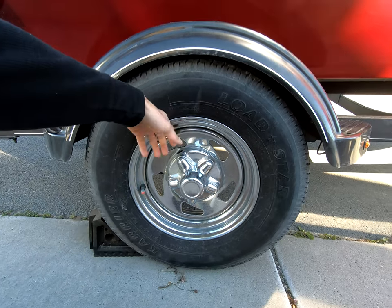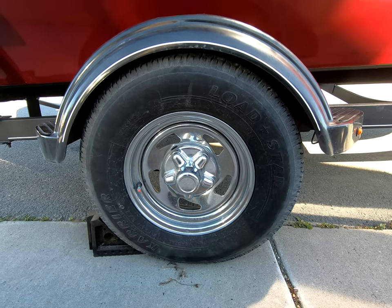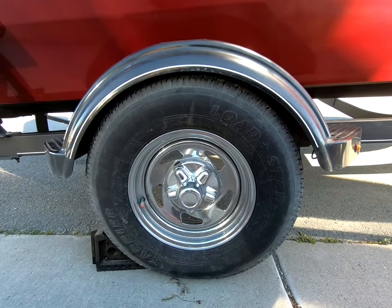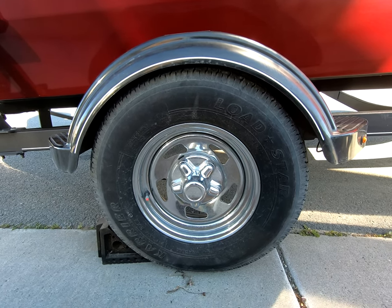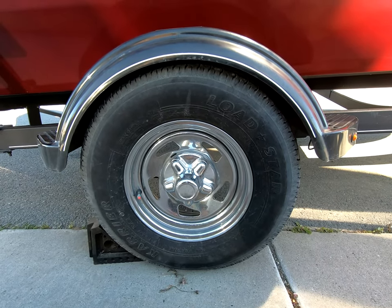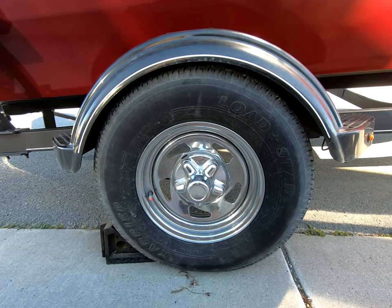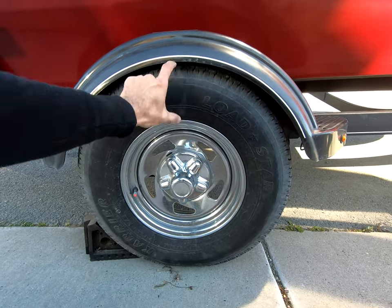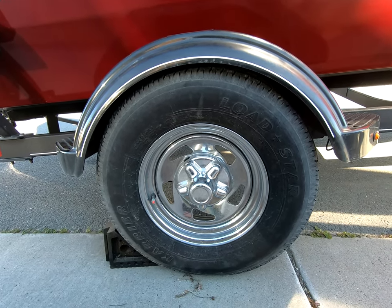In summary, it's a very easy upgrade. I'm going to change out the rims very shortly, which will also allow me to roll a little faster on the highway. These are C-rated tires — I'll be able to upgrade to D or E load rating. I'm upgrading to D-rated because I don't like the way these flex naturally.